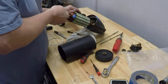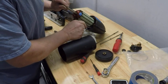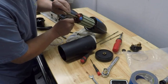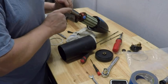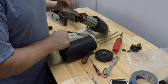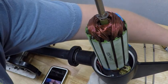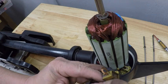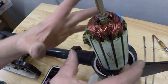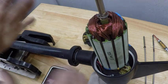So here's what I'm going to show you. I'll slide the armature in — watch, it'll snatch it out of my hand. There you go — it preloaded itself. Now that I've got it like this, this is how it goes in. The problem is if you do it that way you can't get the brushes in the right spot. So you have to load it like this. I've got the trolling motor pointing straight up now so this is locked in place and braced, and I'll show you how to slide the other part on it.